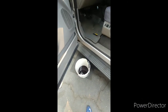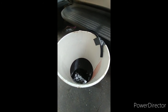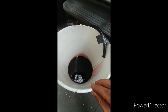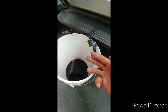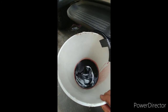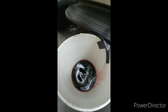That was the first round of the key-on transmission fluid drainage. You can see — I really burnt this transmission fluid coming up the grade. I mean, it's red when it runs, but it's pretty damn dark. Like I said before, it got to about 278 degrees or something like that. The overdrive light was flashing, so I pulled the code and that's what it gave me. I'm doing this as a precautionary measure, but dang — this stuff is burnt and it's only got 4,000 miles on it. So I'm glad I'm doing it.